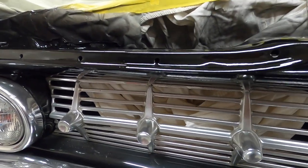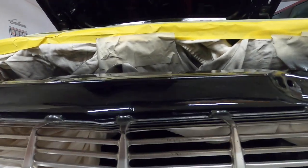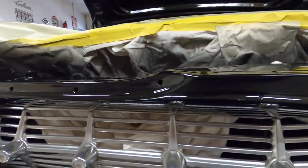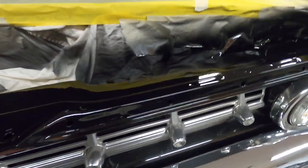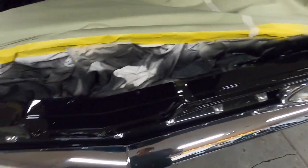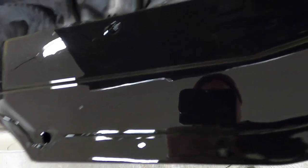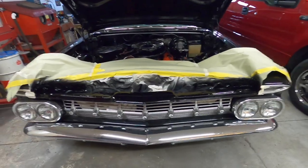It looks good enough - it's mostly going to be covered. The trim and everything will go here, and you'll see a little bit right where I got a speck of dirt, which I'll give a very light 600 or 1,200 grit sand and buff out. I started taking some of the masking off and I didn't really get a sharp line at all - just a little bit of polish without sanding and that'll look good. Once the trim's on, you'll never even notice it was painted and taped there. It looks really good other than that one speck of dirt.